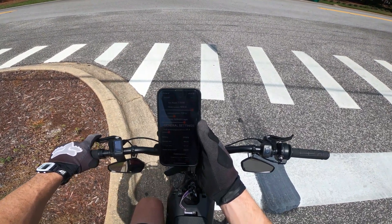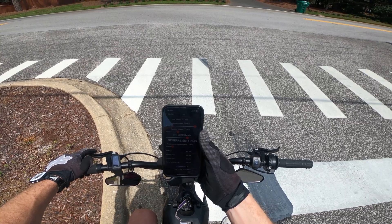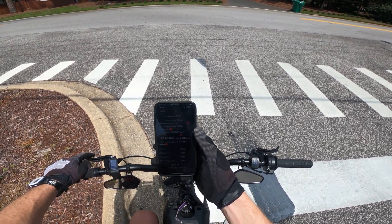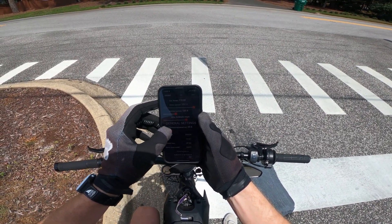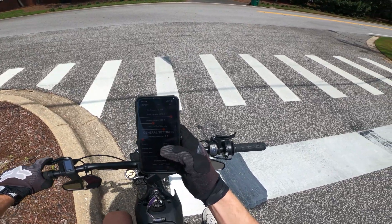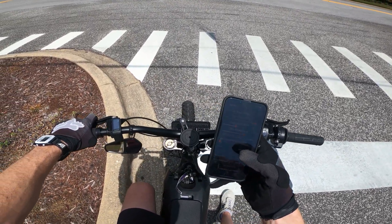This video is going to be for those of you who are curious about the TC500 and its features like field weakening, to help you get an idea of how the feature works and what it could do for your bike with similar specs. We're only going to be in sport mode, not even going to be touching eco. Starting out from the top, we are pushing 7.3 kilowatts with the stock battery, 500 amps for the motor current, 120 amps for the battery current, and top speed set and limited to 51 miles an hour.